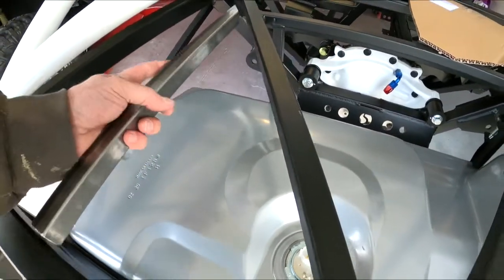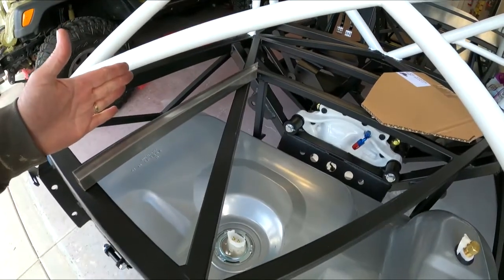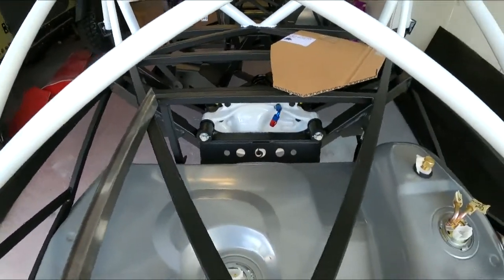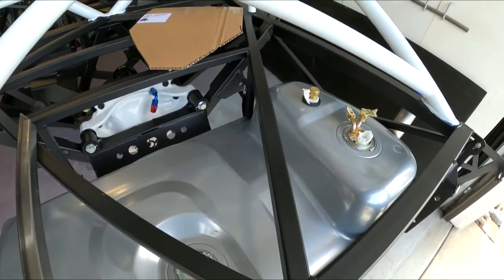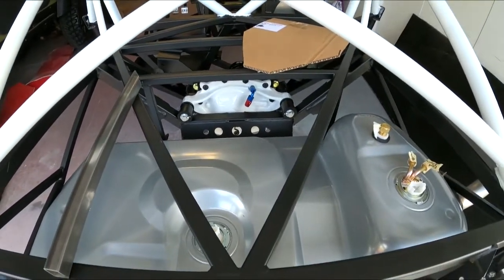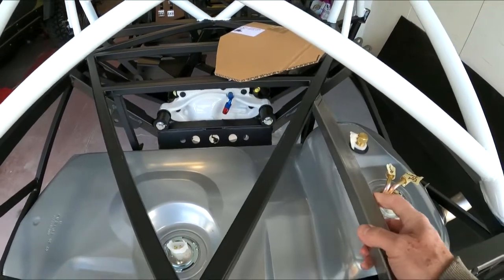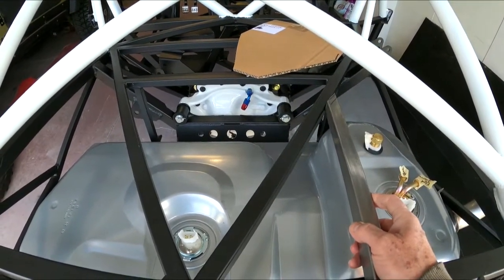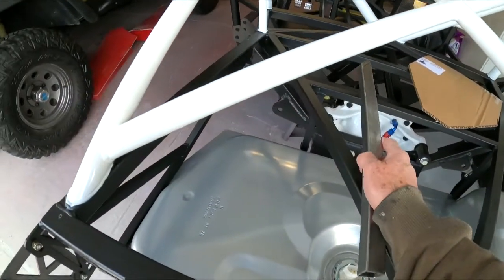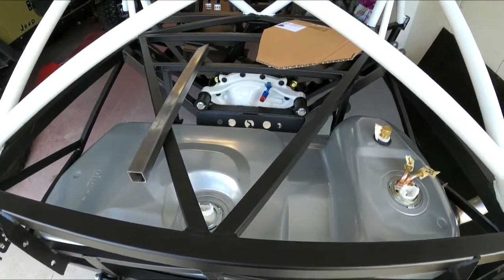You should have this area here. The area under here will be covered with the aluminum plate. If you want to put anything back there you'll have to reach kind of in, but you could put maybe a jack, tools, a jacket, or whatever. So you have a little storage over here and this will all be more open. That's kind of my idea. So I'm going to weld this into place, make another one over into here, probably about right there somewhere. We'll cut another piece of steel and burn this in, and then we can start cutting some carbon fiber.